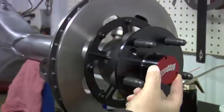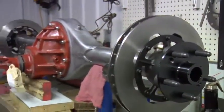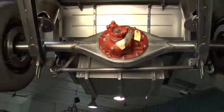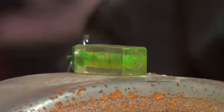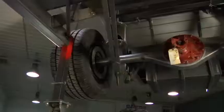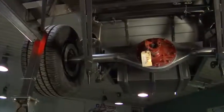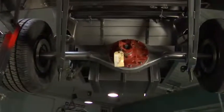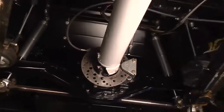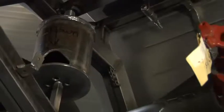To keep the authenticity of these cars, we have a company that builds the rear axles for the stock car racing family, and we've hooked up with them. We have them build our axles basically off of their specifications, and we do a few other things that are a little bit different because our cars are used on the street. We don't need to run an actual cooler for the rear end, where a real stock car does have to run a cooler. But we use things like a nodular rear end. We use a Detroit locker for the gears on it, and we use special axles.